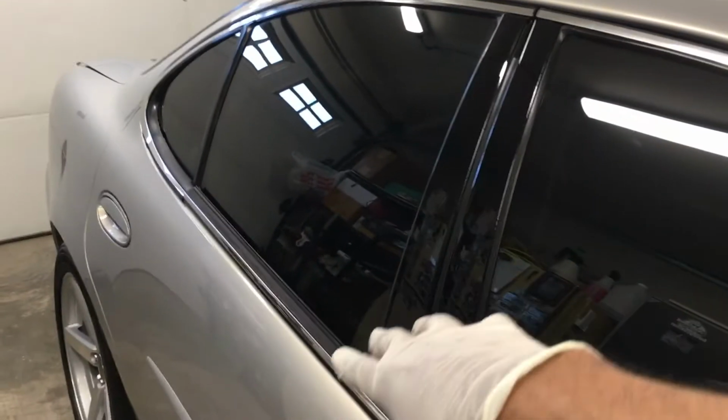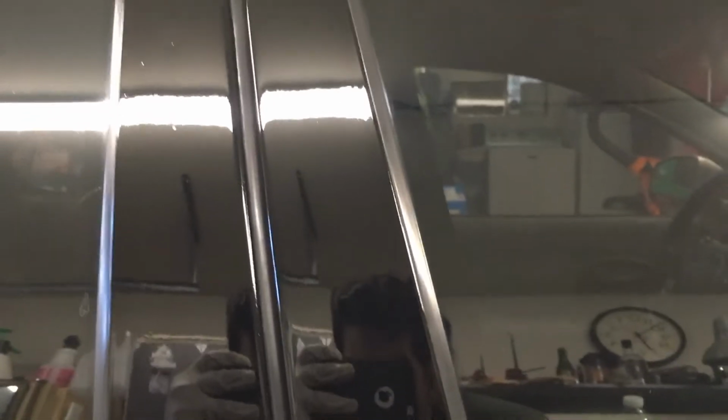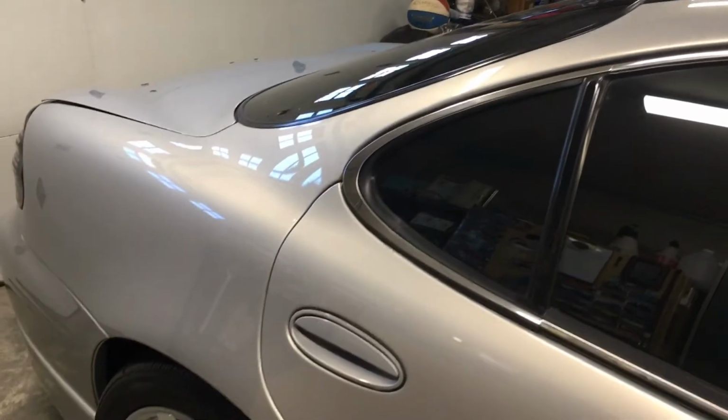These pillars, I polished them with Essence and panel wiped, and then coated with Kenzo, and you can see that they look really good. There's not a lot of defects in here. Just so you see the solvent pop, I didn't do anything on them. You can see bad prep at the paint shop right there. So looks good. We'll do the roof stuff at a later date. I'll do that tomorrow. I'm going to start putting tape lines on there.